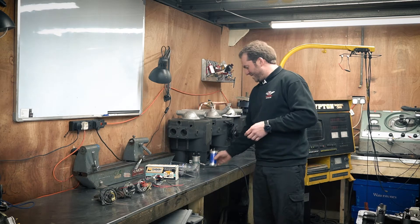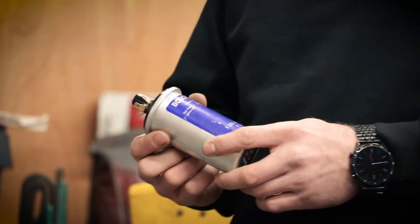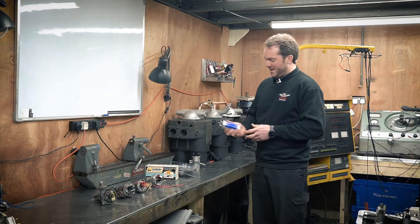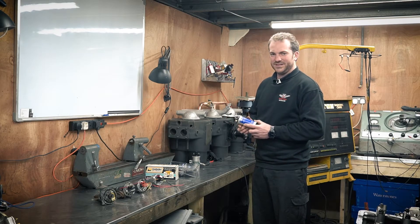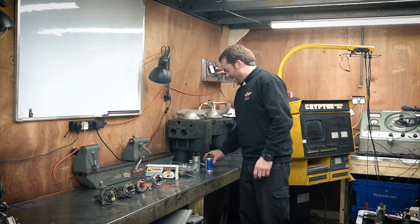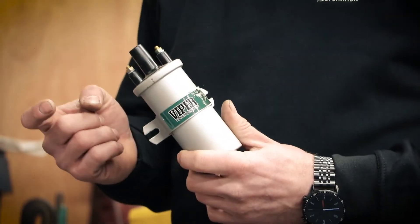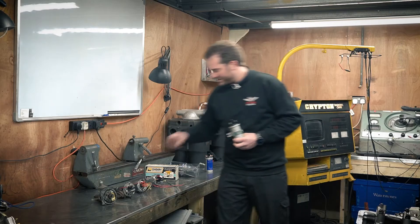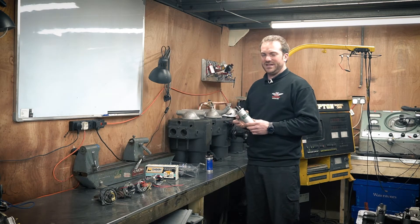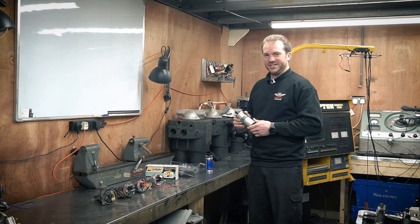The two types of coil I've mentioned: this is my favourite lower-energy coil — 3 ohm resistance on the primary. Most cars will normally replace the coil with this Bosch Blue, as it's called. And this is a high-energy coil — a resin-filled one that came with the PowerSpark kit. It's got a lower resistance on the primary, about 0.8 ohms, so we'll use that for our high-energy electronic ignition kits.